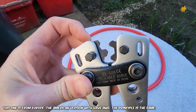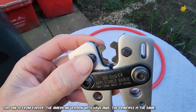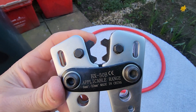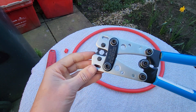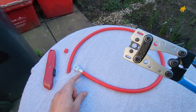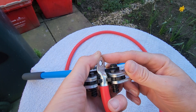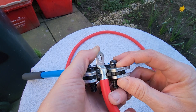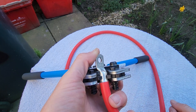Because this is 50 millimeters squared roughly — zero gauge is around 53 millimeters — it's going to work fine for crimping purposes. With both 50s lined up, when we close it you can see the hole will have that gauge right there. Make sure the ring terminal is nice and snug, get our tool around it in this position, and just squeeze it together — and the terminal is crimped.